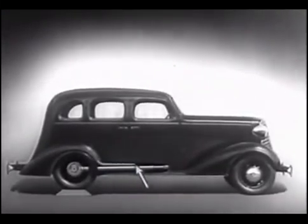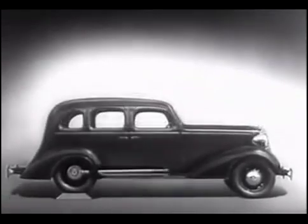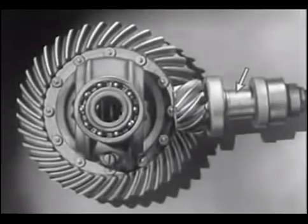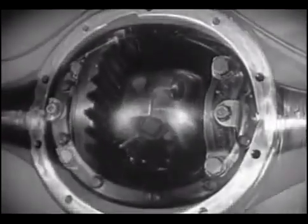We may build the floor of the car above the drive shaft, but if we do, we won't have much room inside unless we make the top of the car high too. Of course we could lower the floor and ceiling, but the drive shaft would be higher than the floor — a shaft in the middle of the floor would be inconvenient for passengers and awkward for carrying luggage. Today, engineers have found a way to make the car roomier and closer to the road without a clumsy shaft above the floor. The drive shaft from the engine to the differential is lowered out of the way and connected to the rear axle at the bottom. The new low center drive makes the rear axle quieter, stronger, and more durable because it gives better, smoother contact between the gears.